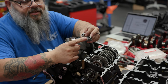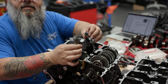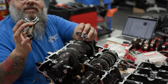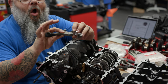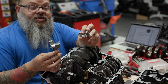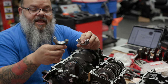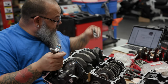There are other connecting rods where, instead of putting these locking pins in place, they make the connecting rod and then they freeze it and snap it in half. When they break it, it makes all these really fine teeth. When you put them together without the hardware in it, that's called cryofracturing, and they do it now because it actually lightens the connecting rod. They don't have to put the pins in, and they don't have to make them so wide down here at the bottom to hold those pins. They can make them a little bit lighter, and they still have the same stay force without putting a locator pin in them. They're pretty cool.